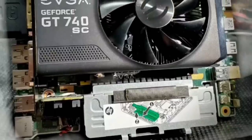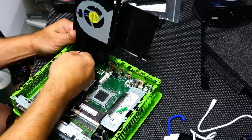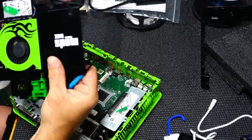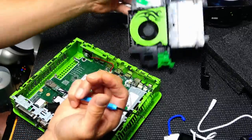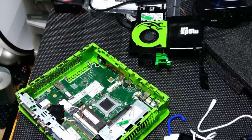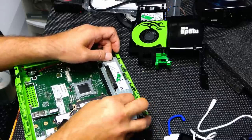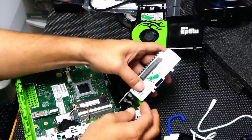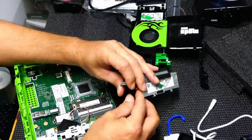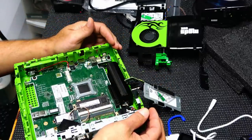I still have that old HP T620 Plus HP Thin Client computer. Now, the T620 Plus Flexible Thin Client is not going to blow you away with its specs. It is an SoC, which means system on a chip. To break that down farther, everything is mostly integrated, like the CPU and the GPU, which are pre-soldered, so no upgrading that. Or can you? You see, the Flexible Thin Client comes with a PCIe 4x slot with a 16x PCIe angle card, so GPU upgrading is available. This ought to be pretty neat.